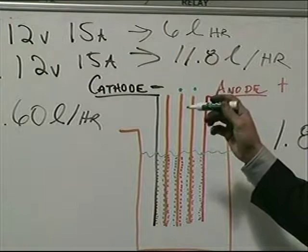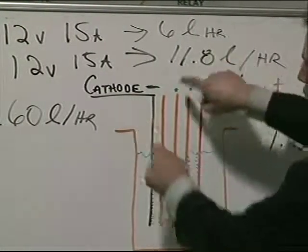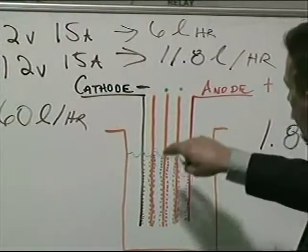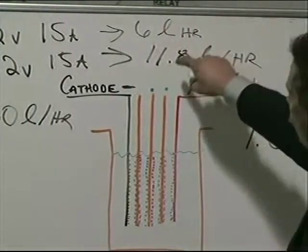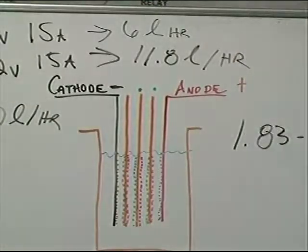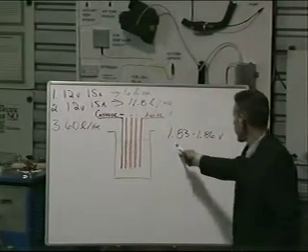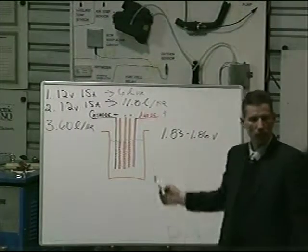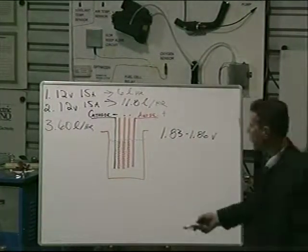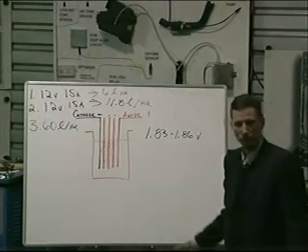Simple division. We take cathode, anode, 12 volts. We throw one in the middle. Now we got 2 6-volt jumps. We throw a total of 3 in the middle, and we have 4 3-volt jumps. 3 times 4 equals 12. At 3 volts, are we still above our threshold? Hypothetically, we could probably throw yet another plate in there and still be above our threshold, huh?